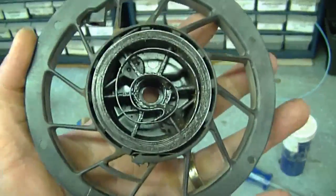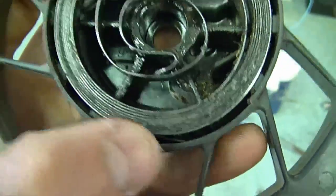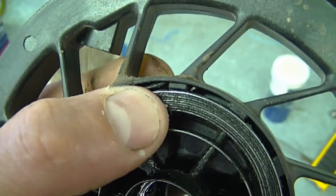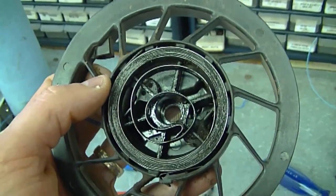The reason why the rope wouldn't retract is because the spring inside here is broken. What happened is the spring broke right here, and the big spring inside basically made a half turn over here — as you can see, here's the other part. What this caused is the spring not to have any pressure on the pulley here anymore to retract it.